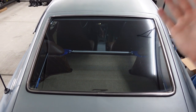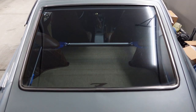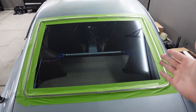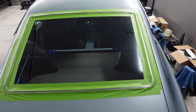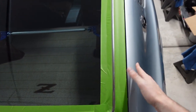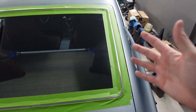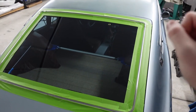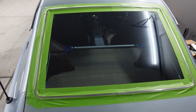First thing I'm going to do is mask off just the chrome, and I'll show you what that looks like. There are two main reasons to mask off your chrome nicely: one, the metal polish is going to discolor any rubber around it, and second, it's also very likely going to hurt your paint. So if the paint on your Z is pretty decent, you don't want to mess it up — really take time to mask it off. Two main reasons: safety and to maintain what you already have. Now let's get down to polishing.